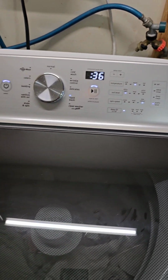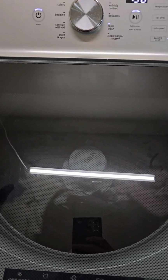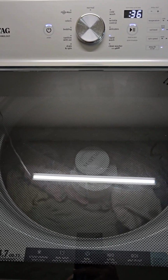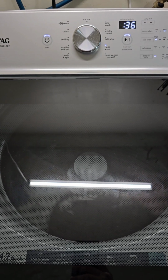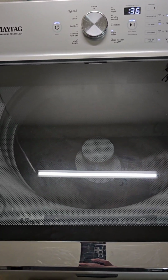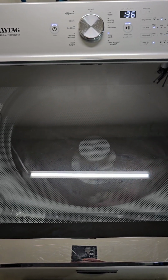It's the fourth time I've run a load through this, testing everything on the board, making sure that the agitator works, shocks are good, bearings are good, all that stuff, everything gets checked, make sure everything's running perfect. Then I do this last load, take a video so you can see as if you're standing here yourself checking it out. Everything works perfect. That way you know when you get it home, plug it in, you're good to go. And so right now it's getting started.